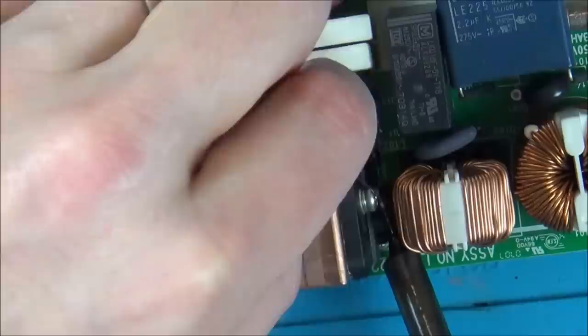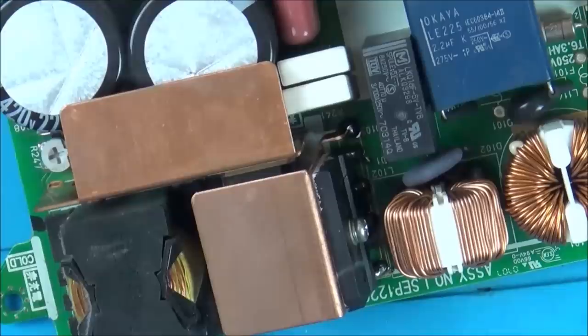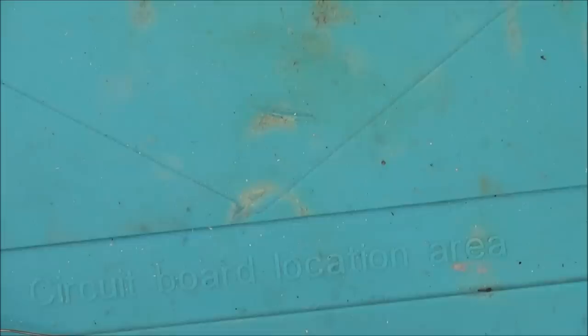Right, so they've all connected apart from the second one here, and there's still a gap on the second one, so I'm going to try and get that one again. Right, and I know what happens with that second one. It's actually melted all the way through there. There we go, I need to push it back through. Taking away the snots of solder that are stuck to the bottom. I'm going to give that a good clean now with IPA, and we'll have a real close look at it.